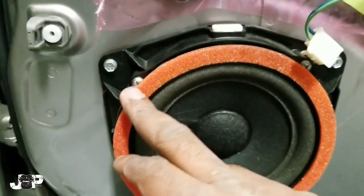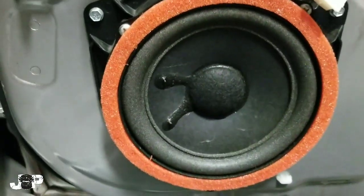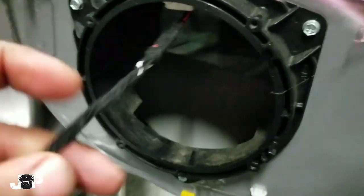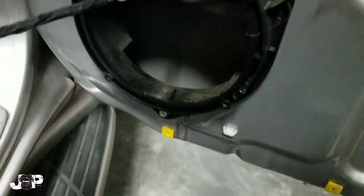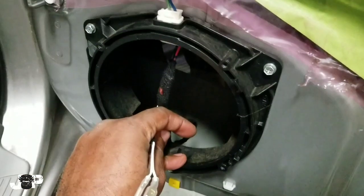I'm going to take out these six Phillips around the side and get that speaker out. What I like to do is go ahead and cut this harness off — red for positive, black for negative — and put it on this little connector that goes directly to the speakers, connect it, test it, tape it, and then zip tie these together and mount our new speaker right here.